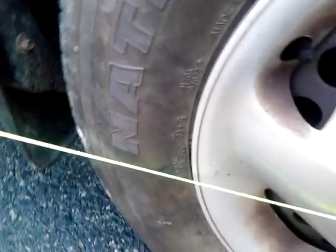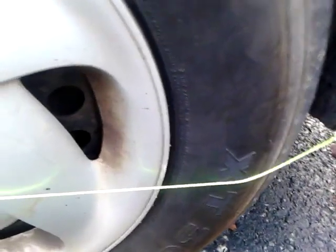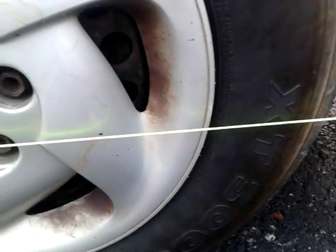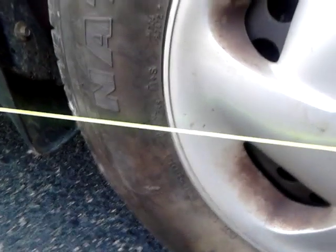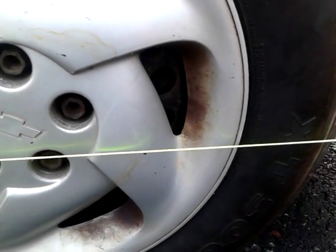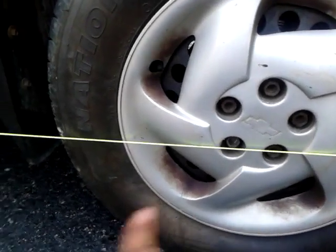When you go up here, this is how I straightened it first to check my alignment, and it was way out. I've already done some adjustments. As you can see, it's touching both, but it's pulled tight against it. You can't really tell unless you pull it off and watch when it comes off - make sure that both sides of the string touch at the same time when you release pressure on it. That means this wheel is completely straight with the back wheel.